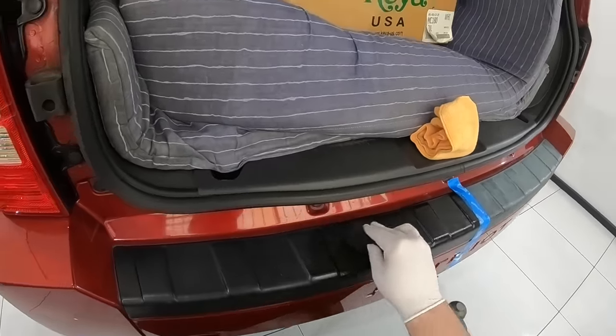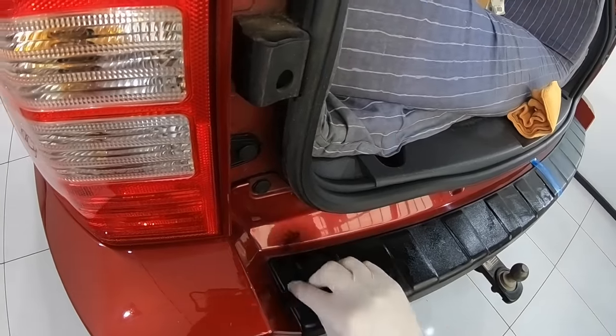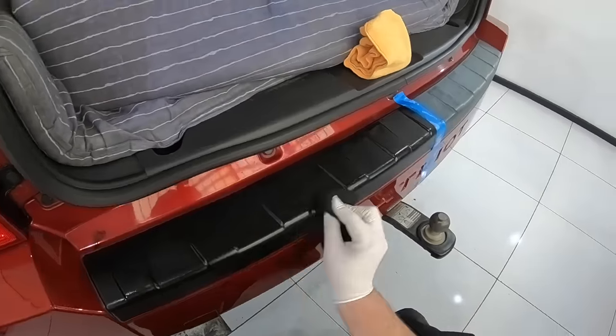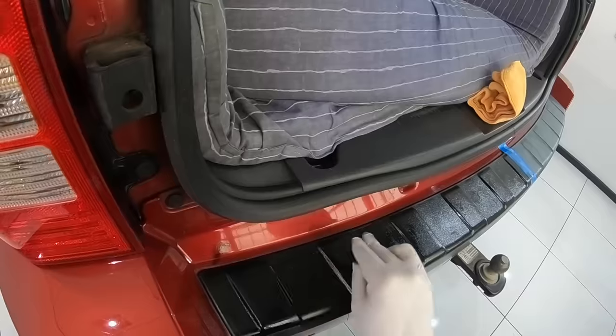After Solution Finish has fully dried and set, it shouldn't come off even with an IPA or alcohol-based wipe down. If it does, it either means it hasn't yet set or that the plastic wasn't properly prepared before you applied it.